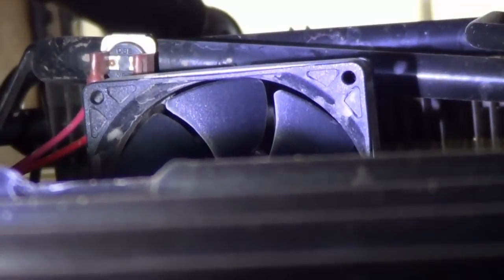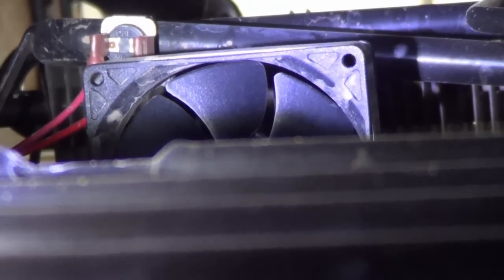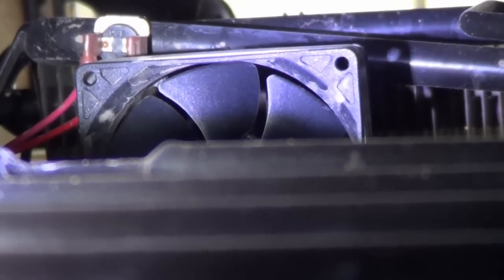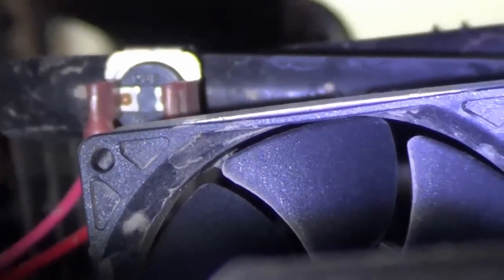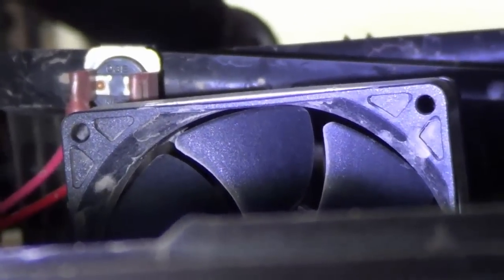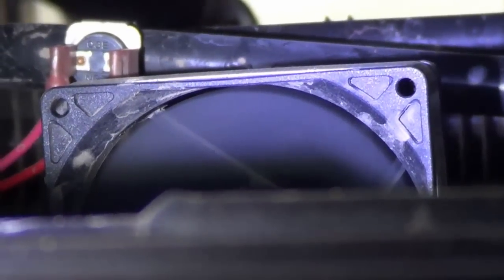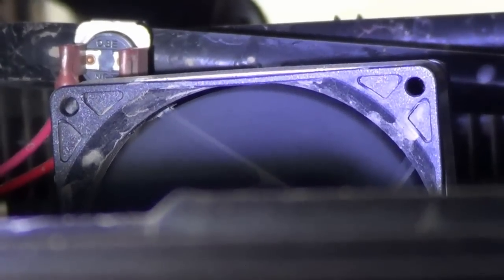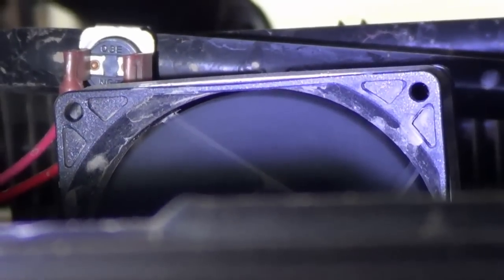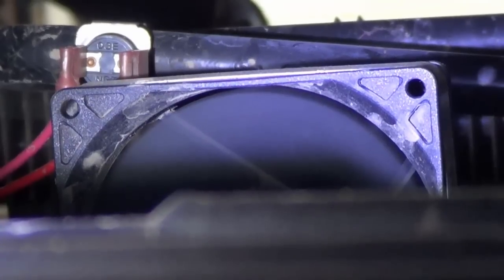So I've been having this issue with my Dometic fridge — the small fan cycling over and over. You can see it there on the coil. Shooting straight up into the fridge, you can see just above it is what looks like a thermostat attached to one of the fridge coils. My theory is that thermostat is turning the fan on, but it's so close to the fan airflow that the fan is actually cooling the thermostat, which then turns off — so the fan's not staying on long enough to properly cool the coils.